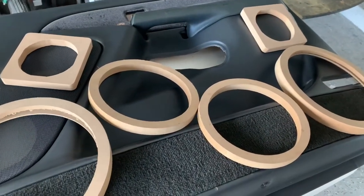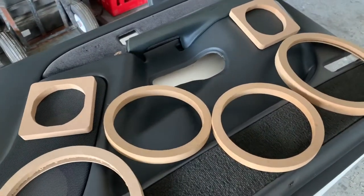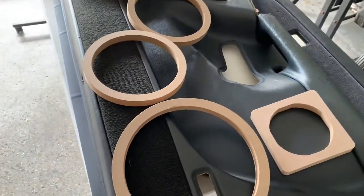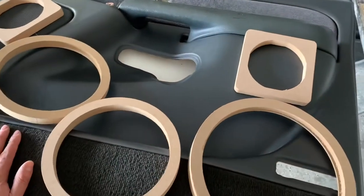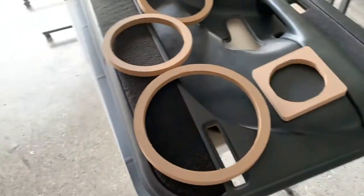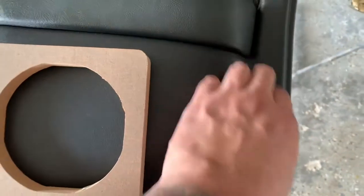Then I'll come through and put little blocks of wood with hot glue to hold them in place. And then after that, we go ahead and fleece her and cut everything out. The ideal would be to put the molds back on the doors and fiberglass them on there so it gets the shape of the actual door so it doesn't warp or taco. Then when the door gets finalized, it sits on all these edges really badass, and there's no lift spots or nothing.